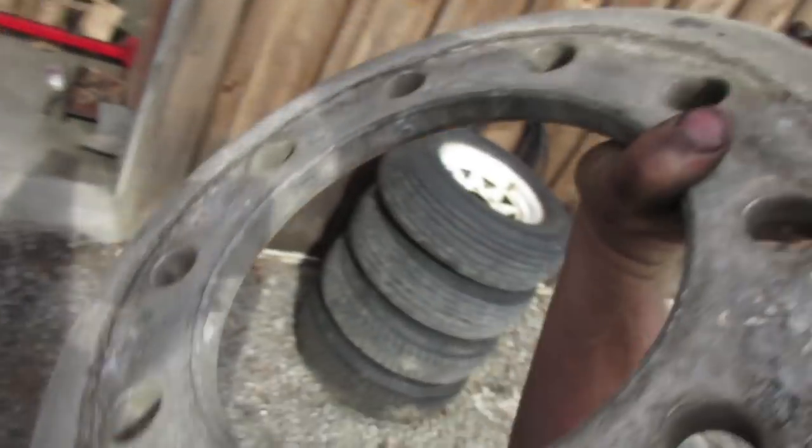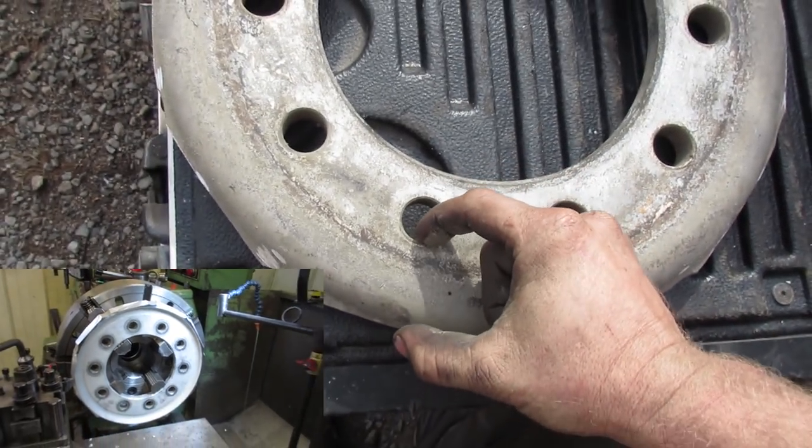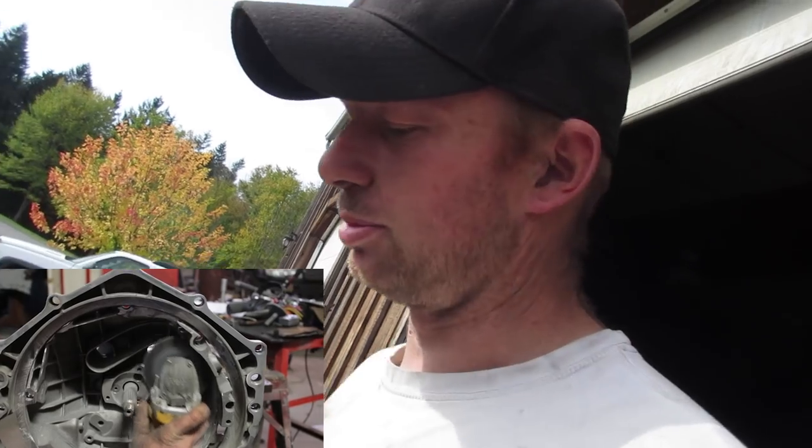And I got the center out of a transfer truck rim. Nice thick aluminum. I need the space from here to here as a spacer for the bell housing from the Audi to the GM. This would be expensive otherwise.